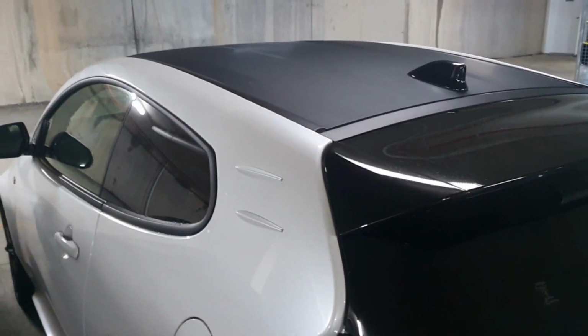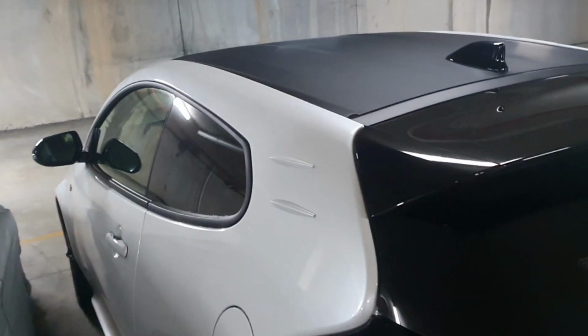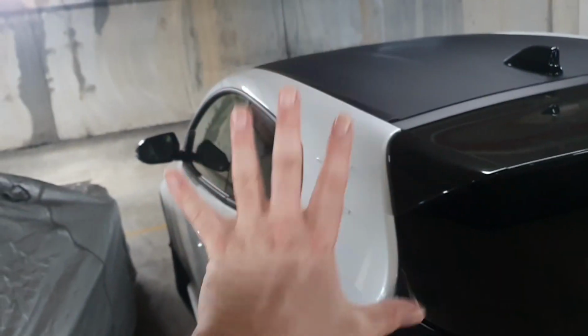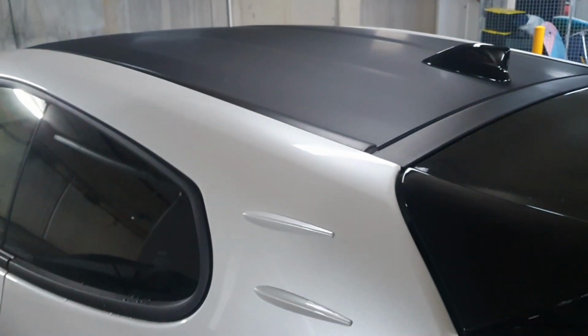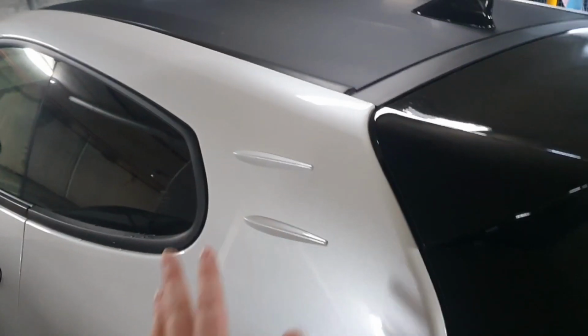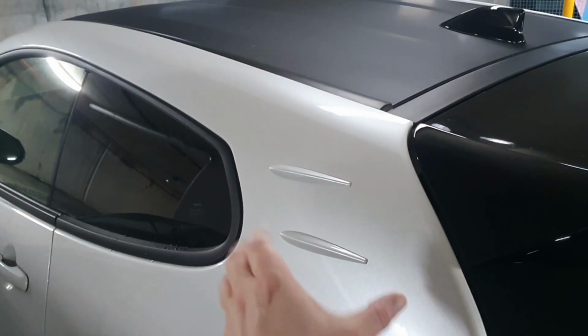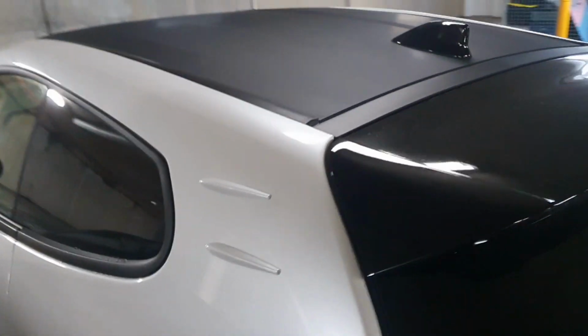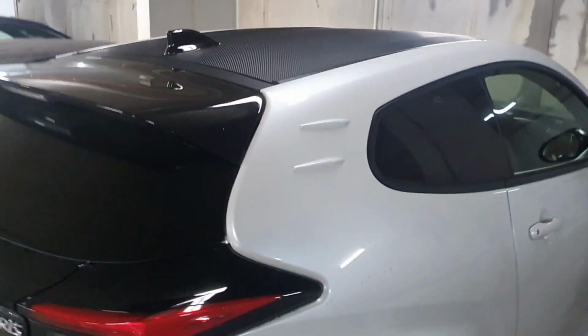But for something like a wall hook holding up something heavy, you definitely want to leave it attached, like just the sticky bit, put the hook on the wall and leave it stuck there on its own for a full 24 hours. The longer you leave it, the better. And then you put whatever you're loading onto the hook. Yeah, so you've got to give the glue some time to get well acquainted.